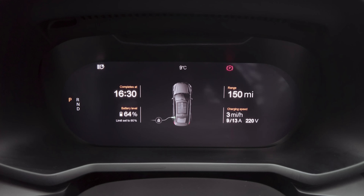I'm going to turn off the air conditioning and see what that does — and there we go, it's popped up to three miles per hour. What I found is that it can't heat the car and charge at the same time. It's one or the other — if you plug this in and you're trying to precondition the car, you're not going to be able to charge the battery because it can't do both.